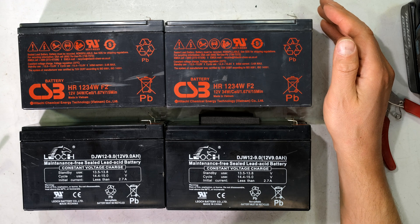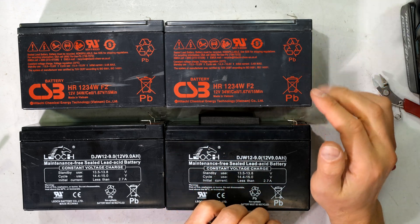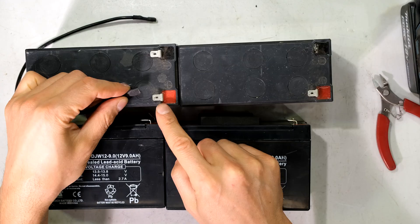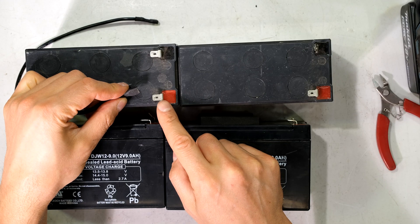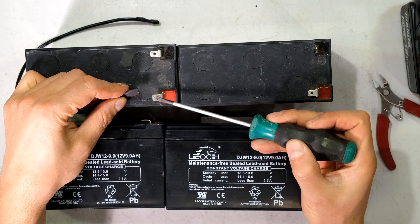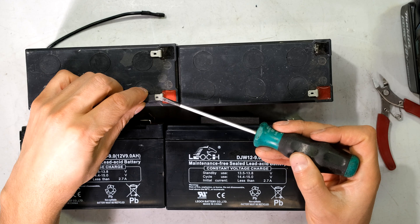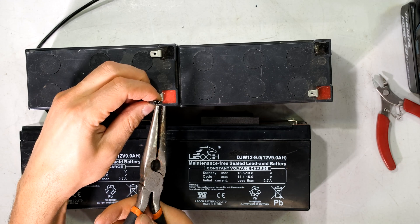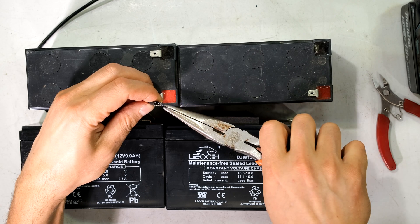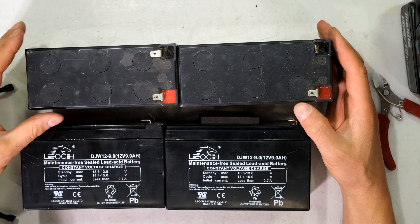It's now time to change the old batteries. Try to replace them with the same specification: 12 volt, 9 amp hours. If you can't get 9 amp hour batteries, I've had some success with 8 amp hour gel batteries. One thing to keep in mind is if you use a different specification — for example 7 or 8 amp hour — the terminal width may be smaller, meaning the connector will be oversized. In that case, reduce the size of the connector mouth by squeezing it with pliers or depressing the sides for a snug fit. Ideally, replace with the same spec: 9 amp hour, 12 volt.